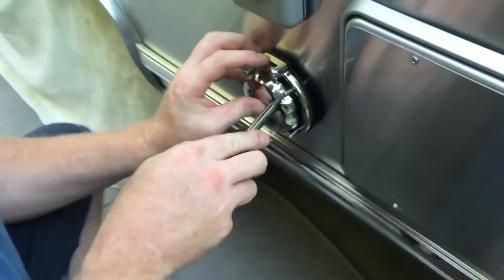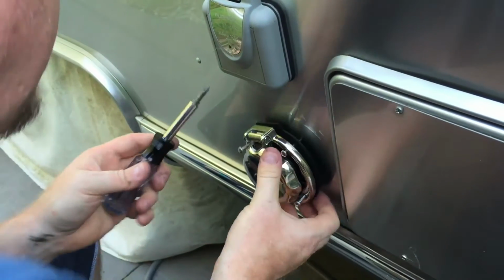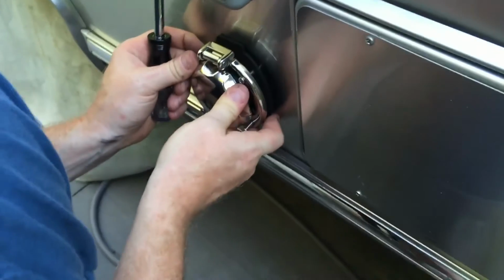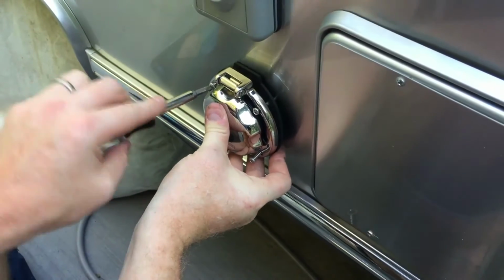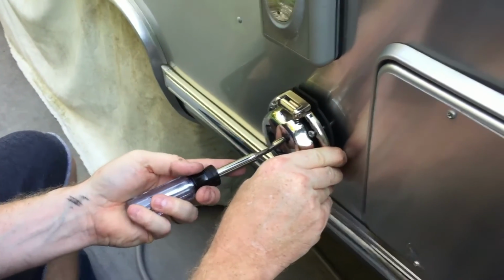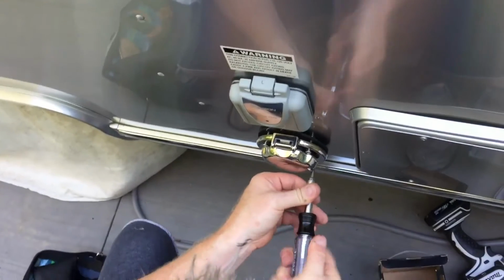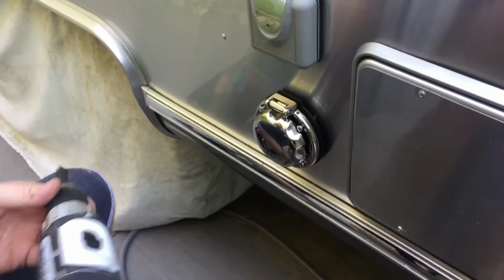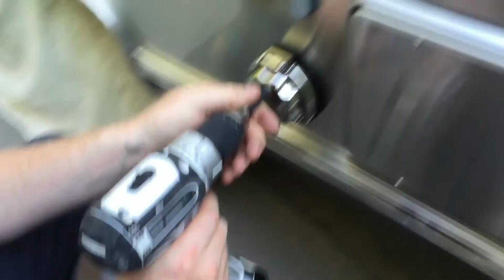Now you take them off with the screw gun, and you can put them on with the screw gun, but I would make sure that they are started by hand so you don't screw up the existing holes. Make sure that you're lining them up with the existing holes. If you're going to use your screw gun, which is not such a bad idea, if you have a torque on it, torque it all the way down and go at a slow speed.